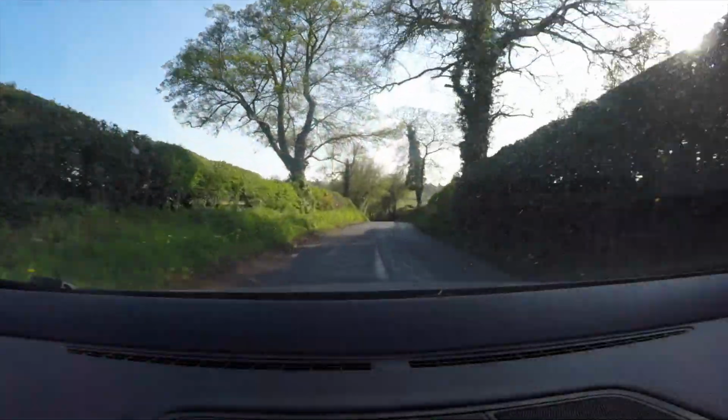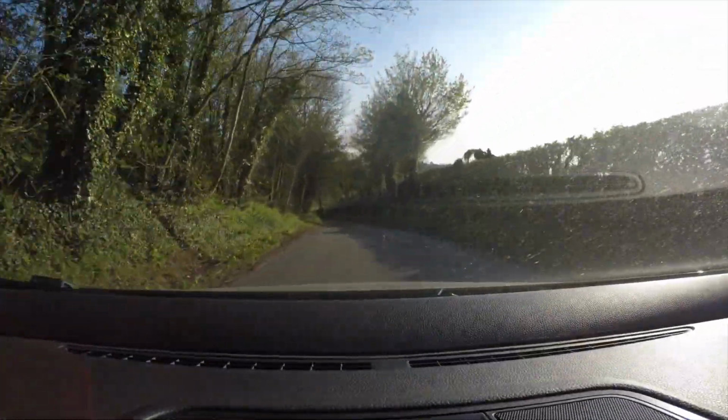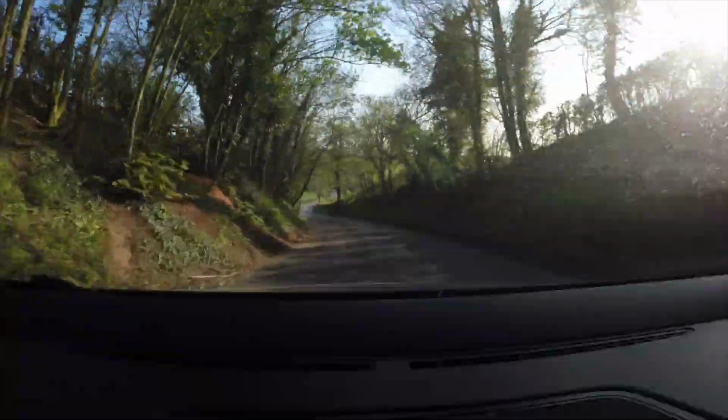Right, so here we've got a lot of rebound going on, simply because of the suspension. I think the shocks must be, I was having a look at the MOT history and also what's been repaired. I think there's a slight leak in the shocks, there might be, but of course, like I said a couple of times now, coilover is coming soon, sooner than you think. Bridge time, listen to how it sounds.